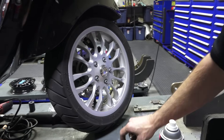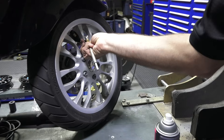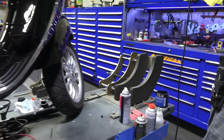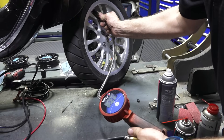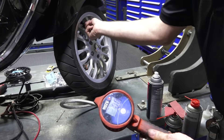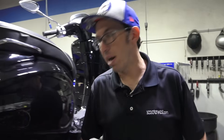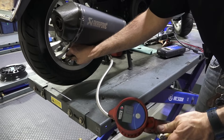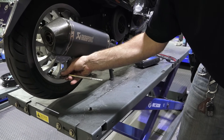Pretty much identical, but the pressure is going to be a little bit lower on the front because there's less weight over the front tire. We're right at about 23 — it was a notch below 25. I'm going to get the front right around 26 PSI. You see it's pretty much identical to the cheap mechanical gauge, and this is a calibrated gauge here. 26 is all you need in the front, regardless if you have a passenger or you're riding solo. I run about 26 for the front on all the modern Vespas. The rear tends to lose more pressure because it runs a lot hotter — I'm going to bring it right up to 34.